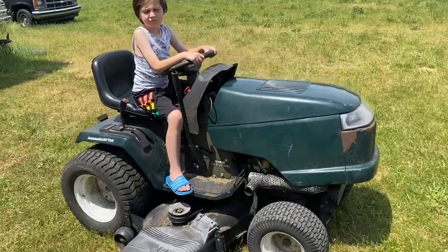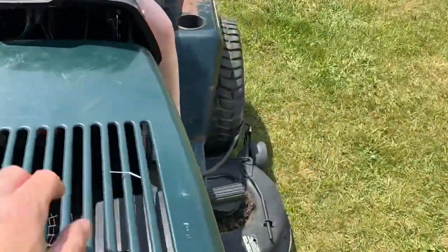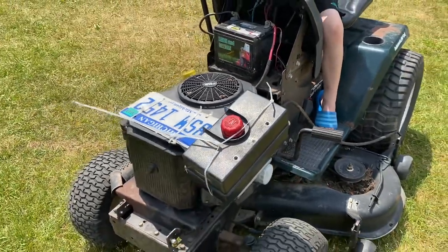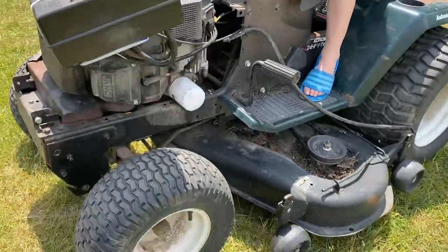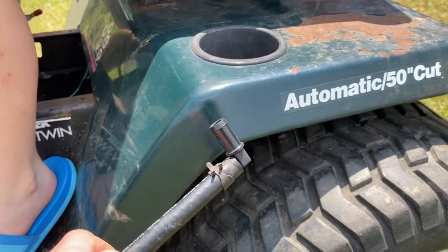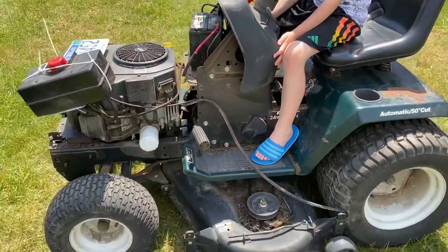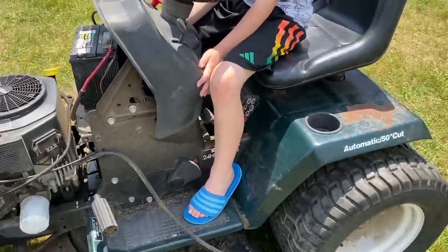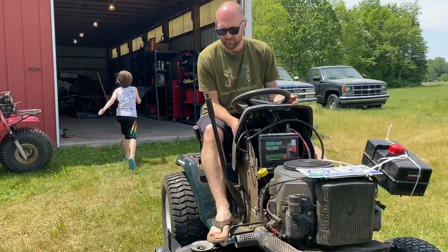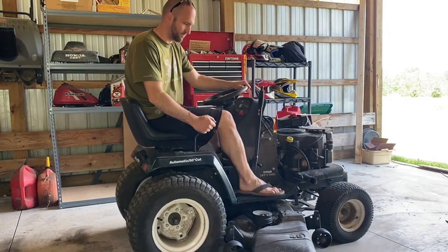What's up guys, today we're back — we've got this free Craftsman riding lawnmower some friends dropped off. We proved that it runs by adding a makeshift gas tank and did a short video on that. There's a fuel tank issue where the fuel tank was leaking, and we found that the fuel line had become disconnected — this little elbow — and there's a rubber grommet that's supposed to be on the bottom of the fuel tank that was missing. We ordered that part and a few other things, so today we're going to be putting everything back together and seeing how it runs.